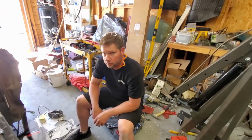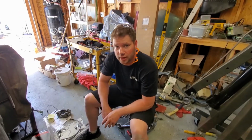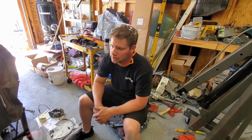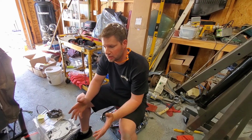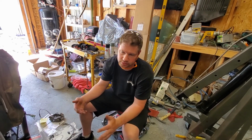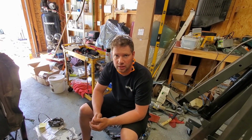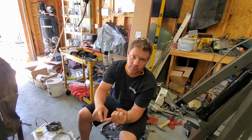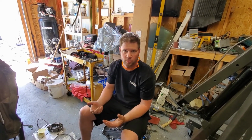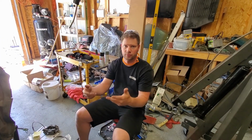Now, we're only throwing in the fronts right now because we are going to be throwing in a new rear end. Tell us about the rear end, Chris. So with our rollers, we like to do the 8.8 inch non-limited slip. So that's an upgrade that the customer can decide if they want to with gearing. So we just get a Mustang rear end GT from '87 to 2004. It's slightly wider, but it's enough that it's not gonna make any differences. And typically you can get them for a couple hundred bucks with disc brakes already on them. So first of all, you get a diff that's stronger than the 8 inch, that's more modern, and you get disc brakes for a couple hundred bucks versus if you bought it and then had to do the conversion, you're gonna be into it another $400 just in parts.